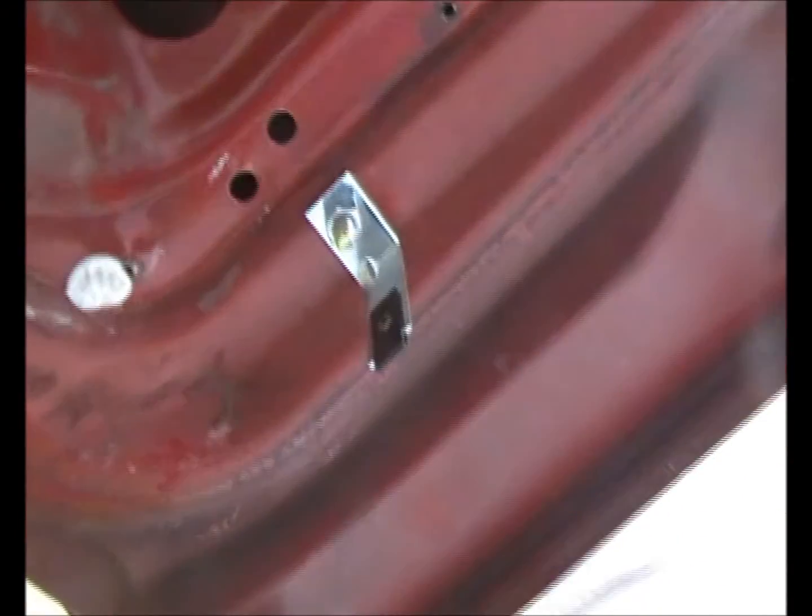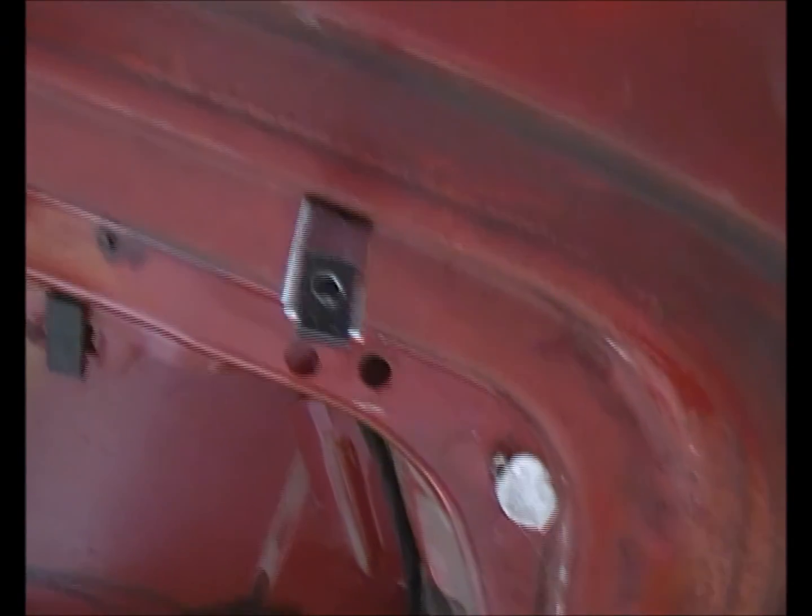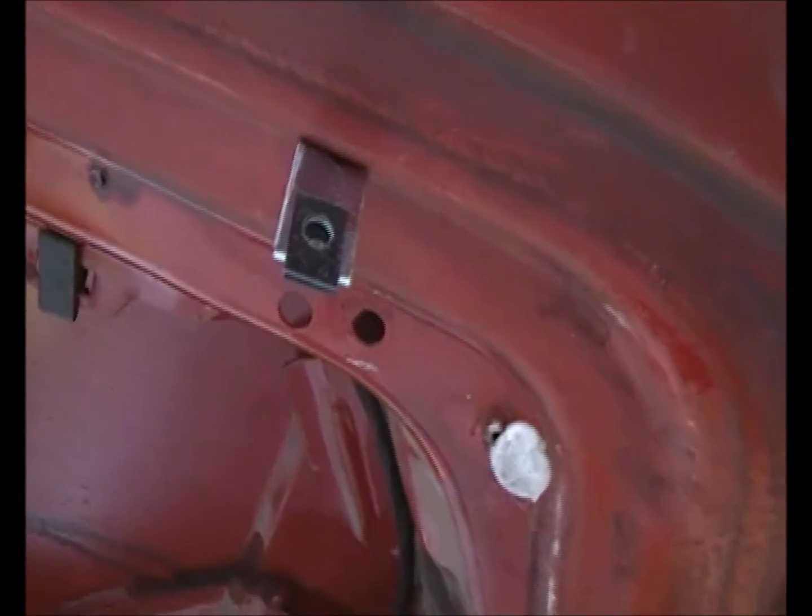As you can see, we've bolted up our L bracket into the hole that we said about. What I've also done is put a speed clip on the end of it, as you can see, which is provided. That's going to grip our screw that we put into the side of the panel. Now, that is 23 centimetres down from the edge of the panel. So that point there to that point there, exactly 23 centimetres. So that's where our screw hole is going to go.